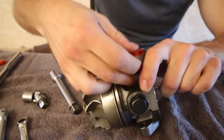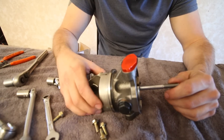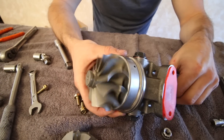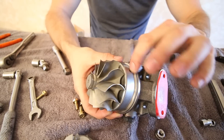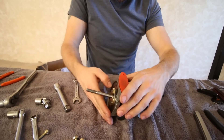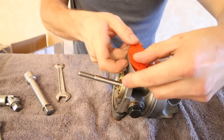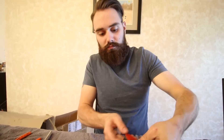To be honest, I don't know how well these work. I'm sure some of you run these and they're just fine, but we prefer an actual ball-bearing turbo, so we're going to go back on eBay because we're still keen on trying out one of these eBay turbos, and we're going to see if there's any actual dual ball-bearing options. We're going to put this one back together — there's no reason to go farther than this. It only has ball bearings on the compressor side and not on the exhaust side. It seems like a weird design that no reputable turbo company uses.